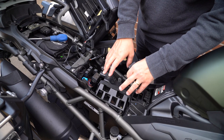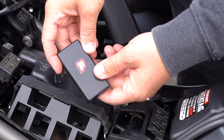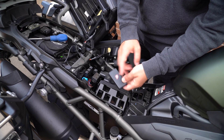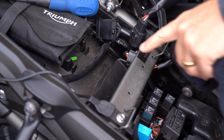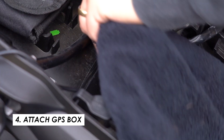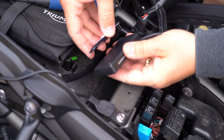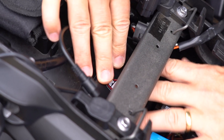You shouldn't need to worry about draining your battery because the GPS unit itself actually has an auto wake-up feature, so it's only on or running when it detects vibrations — such as the bike being tampered with or when it's on the move. There's a decent little bit of flat plastic here just under the passenger seat, so give it a wipe to make sure it'll stick, then put one side of the velcro on the GPS and just press it on there.